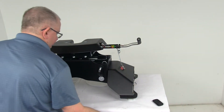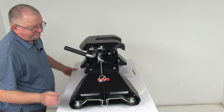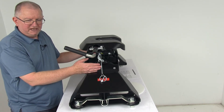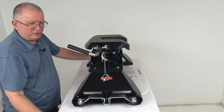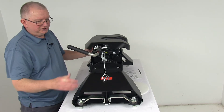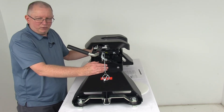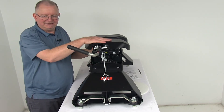I do want to mention the hitch height adjustment. When you bolt these legs to your center crossmember, there'll be three rows of holes, giving you a four-inch hitch height adjustment. Hitch height adjustment is critical because when you go to tow your fifth wheel, you want it to be as level as possible with your tow vehicle. Depending on your application, you can bolt it where you need on the legs to get the correct height. The four-inch range goes from 13 inches to 17 inches, measured from the truck bed to the top of the hitch head.